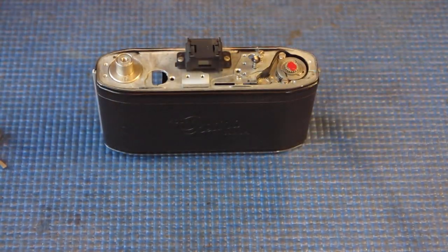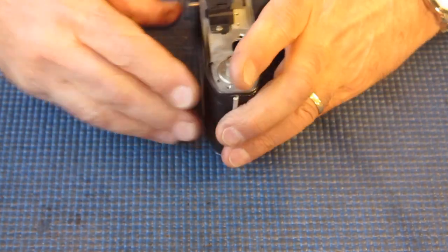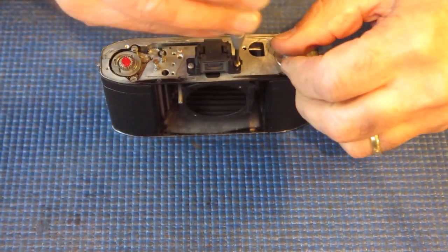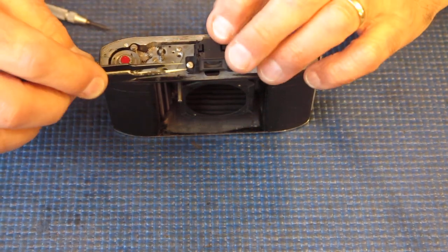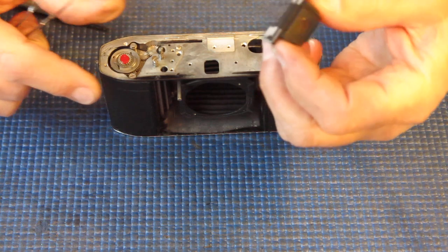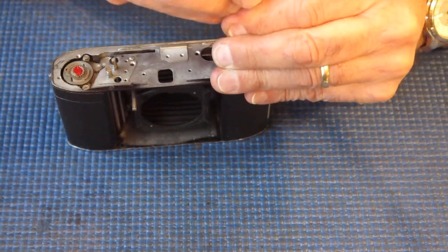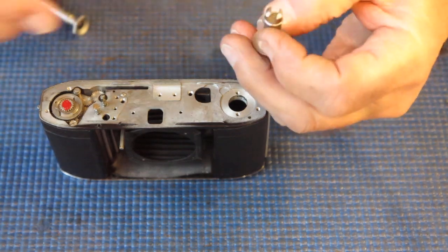This is quite sticky with dried-out grease, though by no means a problem with this particular camera. Cameras that lack a rangefinder — you typically look down and set your focus manually before you take your photo, not while holding the camera to your eye. As a result, if the focus scale is a little bit stiff, it causes no particular problem. It can sometimes even be an advantage because it means you won't accidentally knock the setting of the focus scale ring as you lift the camera up. Cameras with a rangefinder, however, you are focusing with the camera held up to your eye, so it is certainly to your advantage if the focus scale ring moves smoothly and easily.